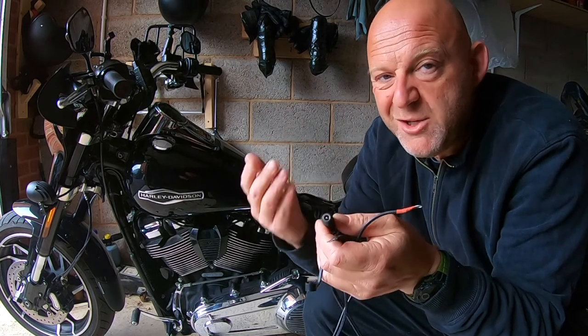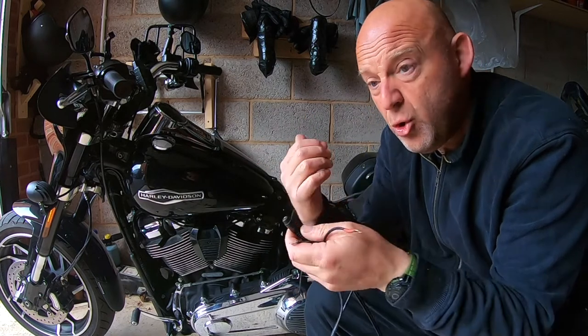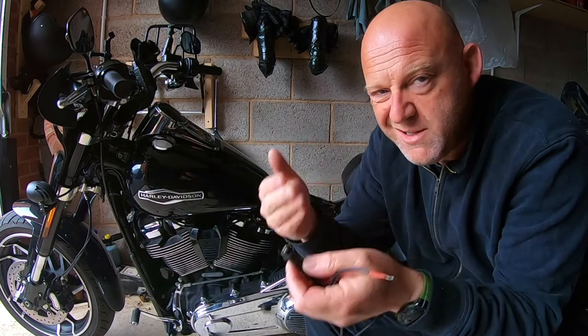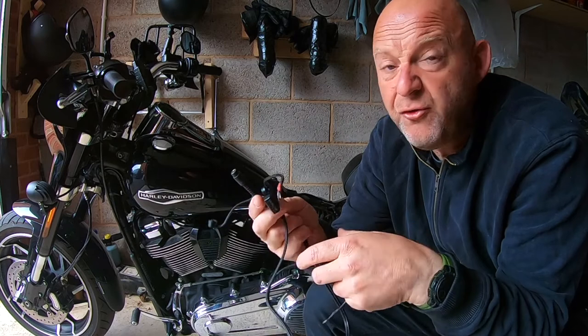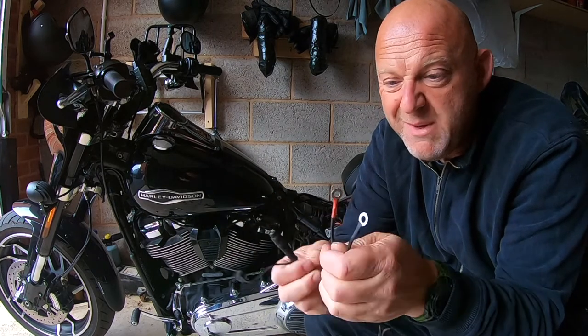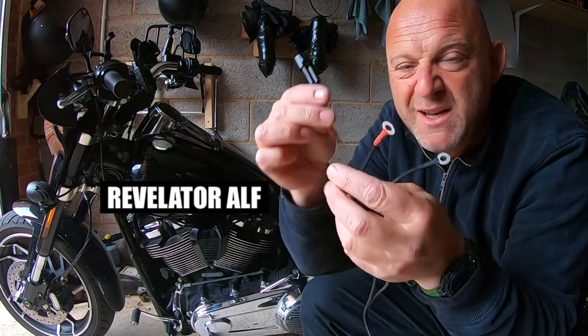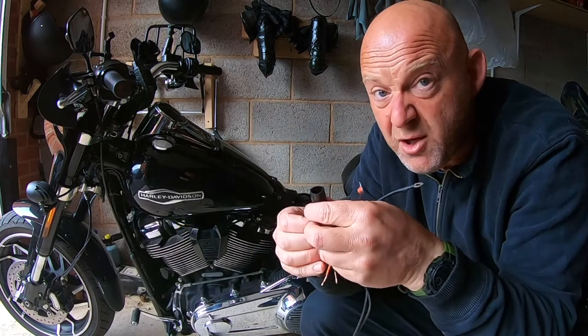So with an electrical harness that you might have for your bike, it just turns on with the ignition, or with the Hex ezCan, which I'm using as my motorcycle accessories manager. That's the way I'm going to do it. So for me, I'm actually just going to be snipping these two off and attaching this Hex ezCan electrical connector to one of the circuits.